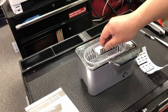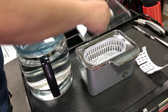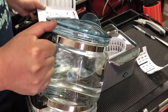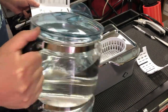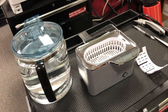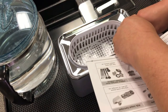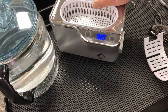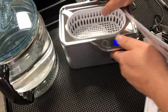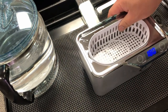I really like how this cleaner looks — it's really slick. Ultrasonic cleans things by creating tiny bubbles. When those bubbles burst, they create a cavity which cleans the object. This is why you always want to suspend your object in the water, and that's what the basket is for. I also like how they designed this power cord — it has a spill guard, so if you accidentally spill some liquid, it's not going to fry the cleaner.